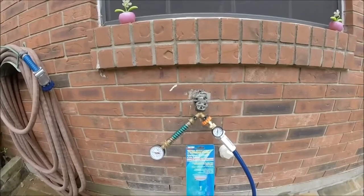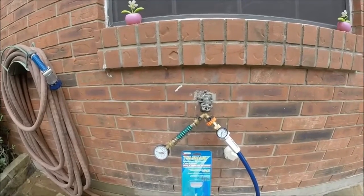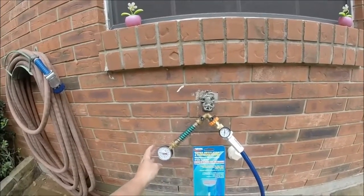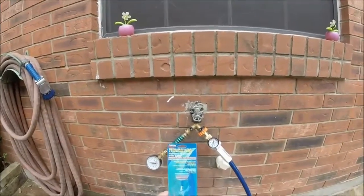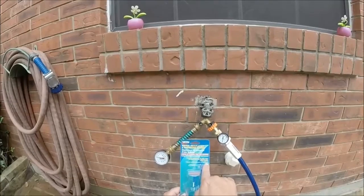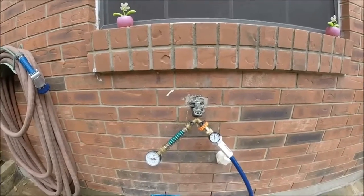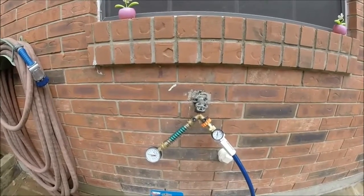So here's what it looks like. I've got a contraption I've built that I use at my RV sites. One component is this Valterra water pressure regulator gauge, and then this general water pressure testing gauge — you can buy this one at Home Depot, and this one at typical RV supply locations. This one is designed to keep outlet pressure at 40 to 50 pounds per square inch, so even though this side will likely read 60 pounds, this one will only read 30 or 40. It should start at 40 and if I use the water it'll drop to around 30.